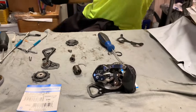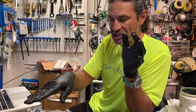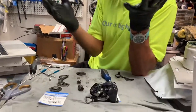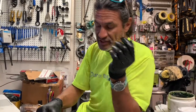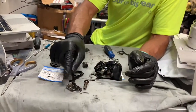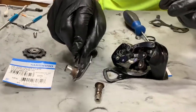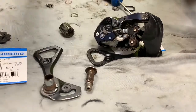The reason that we replaced this is the derailleur cage was not bouncing back, and neither was the B-axle assembly — but you can't get the B-axle assembly anymore. And then just as we took everything apart, that's when we discovered all the corrosion and the pitting corrosion that was going on on this plate here. So that's why we replaced it.